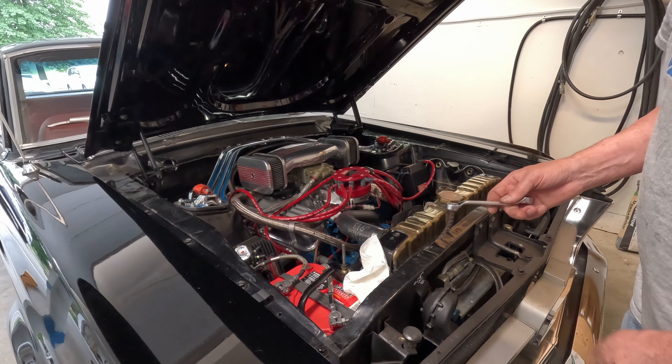I bought this one before winter thinking I was going to get to it. Six months later I got to it — bought the wrong starter. The only thing different if you call Powermaster is this flange, and you can buy another flange. You can see how they're different. I can buy the flange I need for $54 from Summit — it's part number 9503-03, the adapter by itself. This is the corrected one; this is the wrong one for my application. Before you order the starter, measure that depth or take your old starter out and check it. There are instructions that talk about how to measure all this.